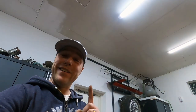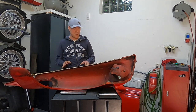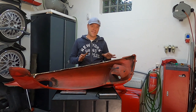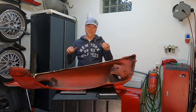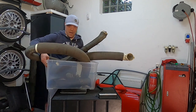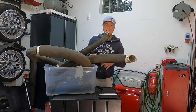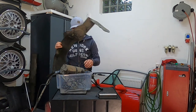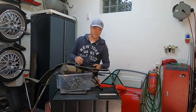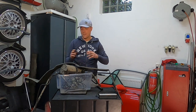Scoring time. The fenders: 8 kilos each — so 16 in total. The carbon fiber alternative is about half, meaning I'm down 8 kilos just on the fenders. The anaconda nest — the heat tube going from the back to the front with all the flaps and valves — that's another 5 kilos, bringing us to 13. The little cover plates, carbon canisters, and some leftover C4 pipes add another 2 kilos. So we actually found 15 kilos in total, with a few other bits and bobs not counted.